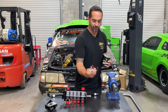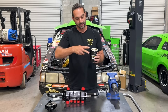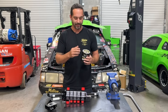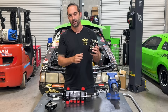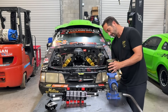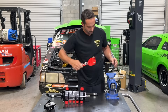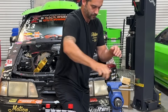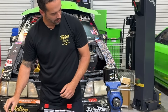The easiest way to cut open an oil filter is with an oil filter cutter — this is an inexpensive Amazon unit; several companies make them. In a pinch, you can use tin shears or even a Sawzall around the top. We're just going to cut along the top of this ring, like opening a food can, and then pull the filter element out.